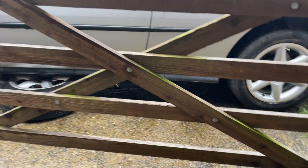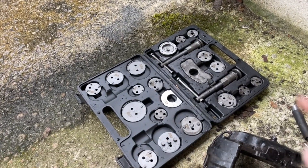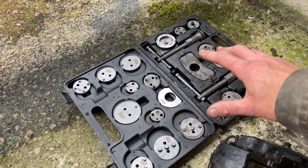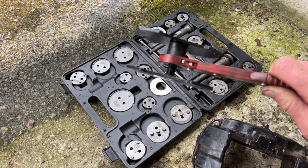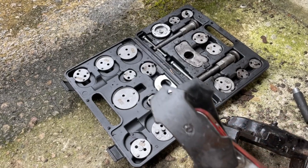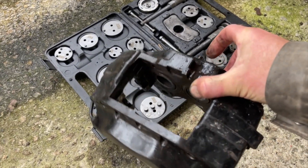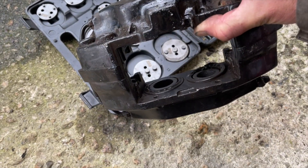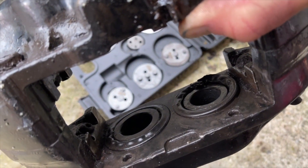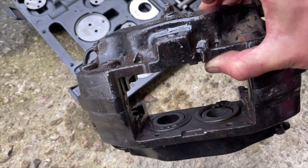The offside front isn't done for reasons we'll come to, but I figured the near side front would be an easy job. The problem is that last weekend I couldn't do the caliper rewind because the tool doesn't fit the Brembo four-pot calipers. So I had to buy a different rewind tool — which is actually superb. However, on the front near side caliper, one piston went right back with ease, but the other side — that doesn't look good and it's going to need redoing.